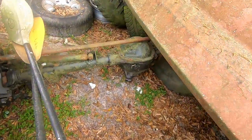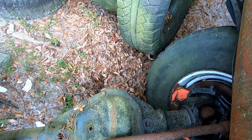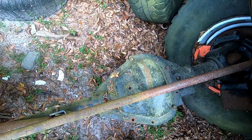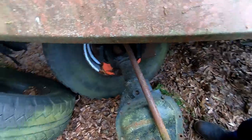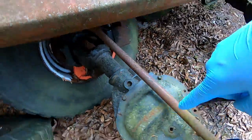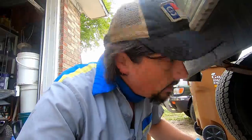I can see them things coming down the road and tell what it's got under the front end because I'm used to looking at them. And then in this pile of parts I got back here, this is a Dana 60 right here. It looks just like a Dana 44, it's just bigger - you notice how big the tubes are. And this also has kingpins on it. If you have one of those under your truck, you either put it under there yourself or you got a K-30 from the factory.